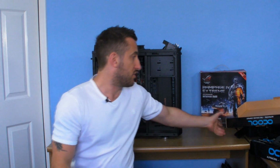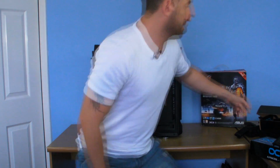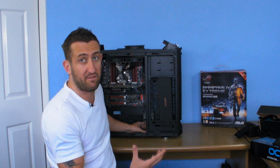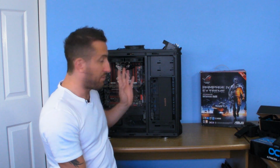Today what I've got to show you is the Alpha Cool, get the name right, it's the XT45 in the roof, then I've got the Monster, which is the 80mm thick, in the front. I've also got a dummy version, or like half a version, of the Bits Power D5 pump and res thing in there, put the motherboard in there, got a graphics card in there, just so that I can get my eyeballs round where everything's going to go. It also helps me work out hosing as well, because these are all things that you should give yourself a chance to have a look with.